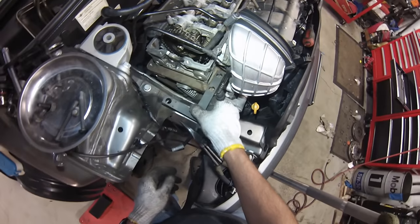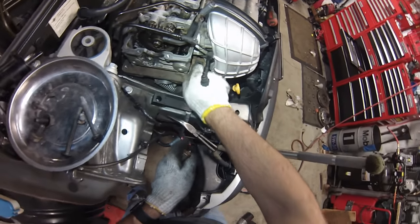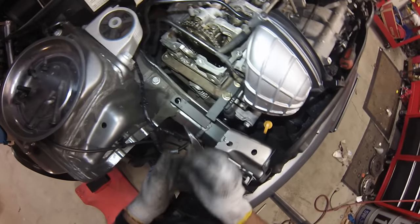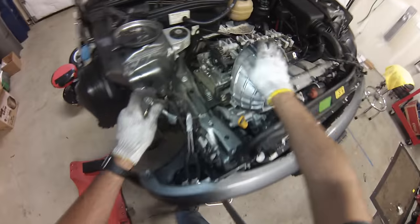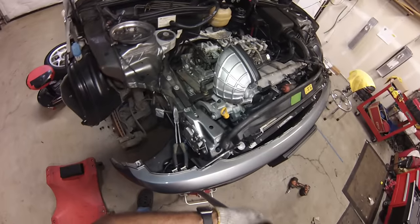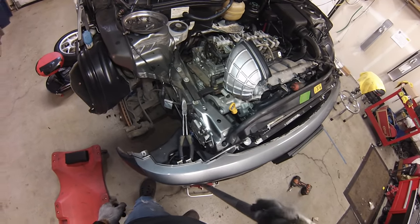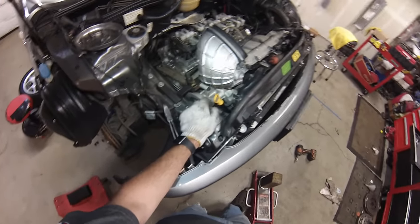The tool also comes with a bracket that allows you to rest the entire weight of the engine on the bracket instead of the floor jack — that requires removing the engine mount itself from underneath the car using an E12 reverse Torx socket (in a pinch a 10mm will fit over it). Locate the bracket, install it with the provided bolts, and lower the engine down onto it. If you don't have these tools, you can just use the floor jack for the entire job.